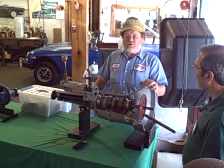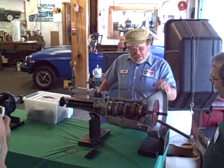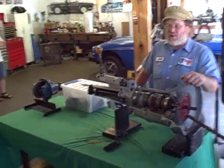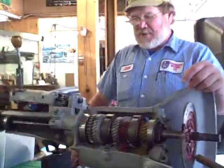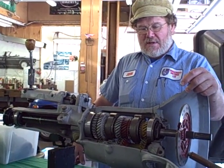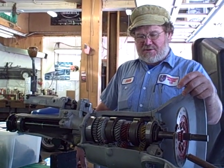This is literally a torque converter if you want to think of it like that. It changes the torque coming out of the rear end. It's obviously designed to take the engine, which is producing most of its power between say 2,500 and 5,000 RPM, and yet allow the car to run at speeds of 5 miles an hour, 20 miles an hour, or 90 miles an hour, using the peak performance of the engine where the horsepower is greatest.